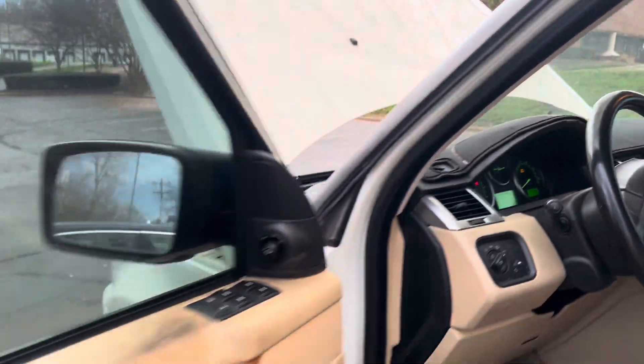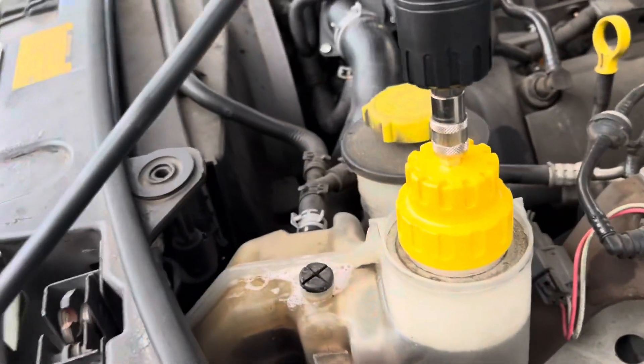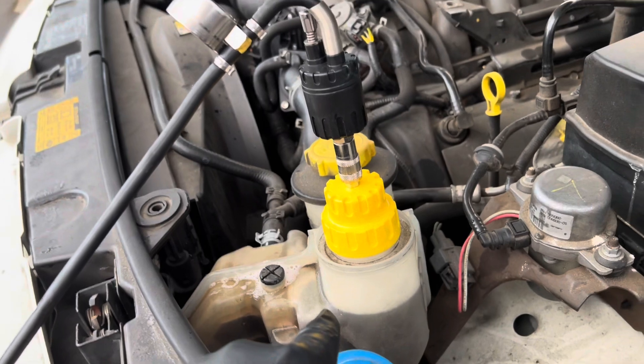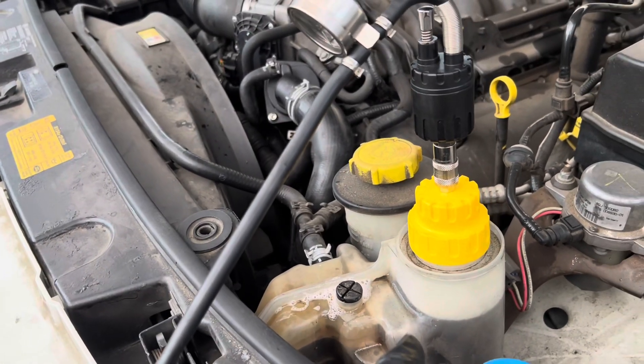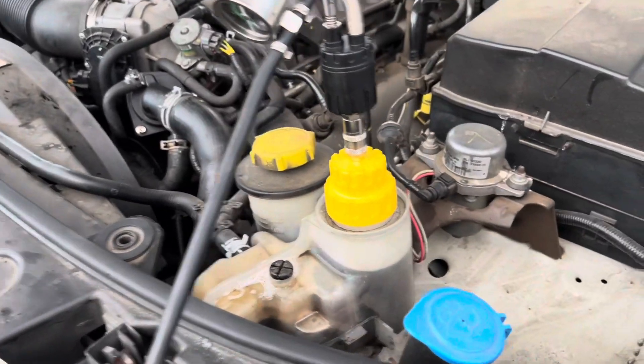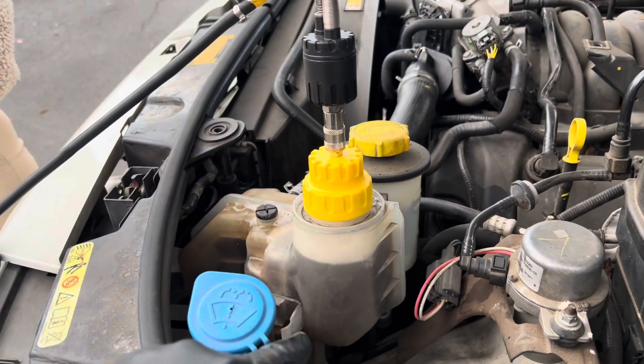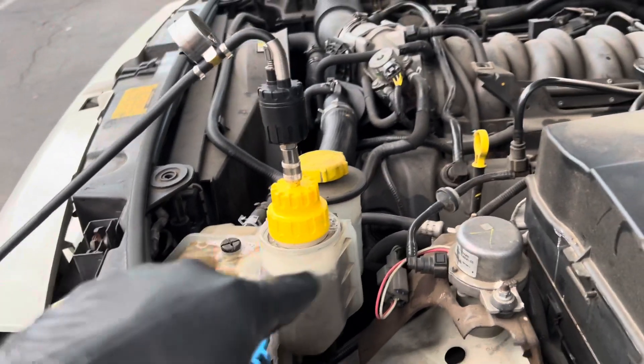Not only that, it needs the proper type of coolant. We're using water because some of it was lost. Now we are creating bubbles over here — it wasn't doing this before. I do think it is starting to kind of overheat, and because of that this is going on. The water has turned dark — this was pink before.